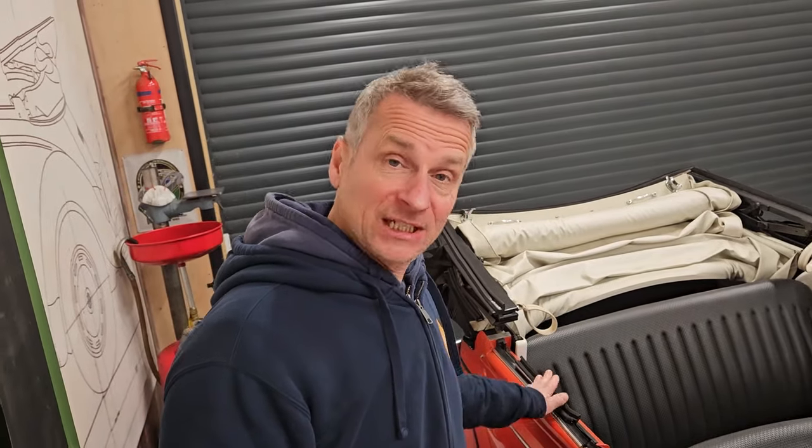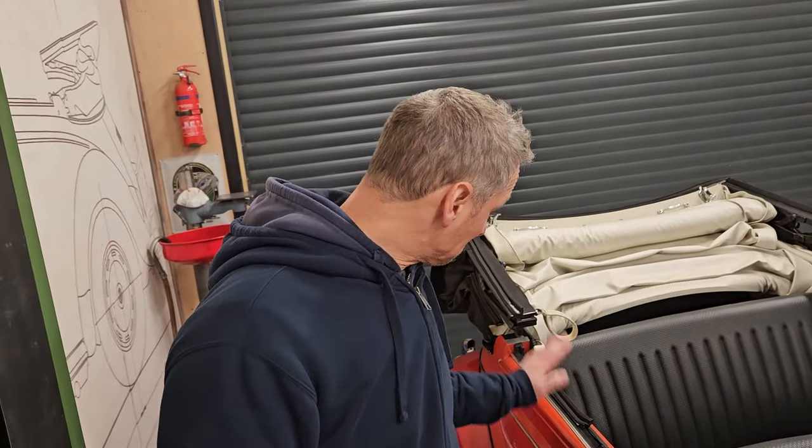And now the door shuts really well again — got rid of that horrible clunkiness and it's lining up properly. Now I can crack on with the job I actually intended to do in the first place, and that is replace the door rubbers on both sides because they're quite perished and old now, and these rubbers on the quarter windows as well. These actually meet the window frames on the front. I wanted to make sure the door gaps were correct before fitting the rubbers, and now I know I've got a good gap I can get cracking.